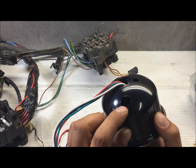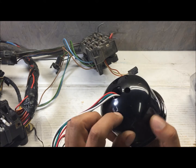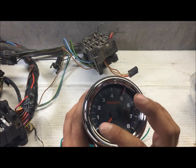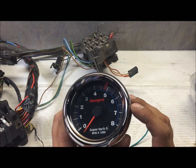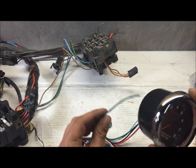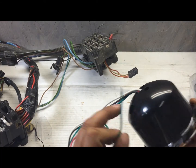That's the reason for this. They should all have a 4, 6, and 8 setting. It's already set on eight cylinders, so it's going to take the pulse and divide it by eight and give you an idea where you are. So people saying that this might be off — that doesn't make any sense.